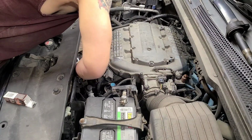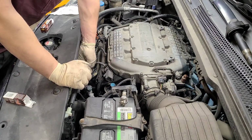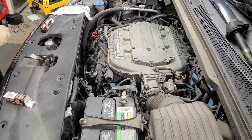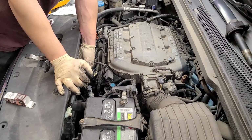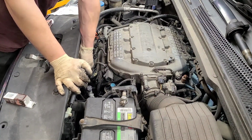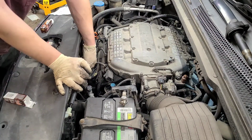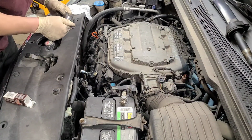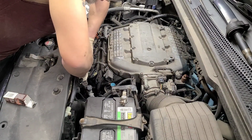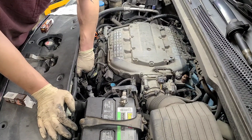So, yep. Let's get it to work in. If it comes off, just wiggle around and make sure it sets and start hand tightening. Get my little extension again, just to give me a little more leverage, a little more grip area. And this will be the last cylinder. And we have all plugs changed, and we will start the vehicle after we get everything tightened back together, before we put the cover back on. See if I got enough clearance there. Let's see. It should be. Yep. Tight a little bit.